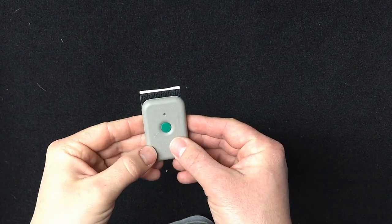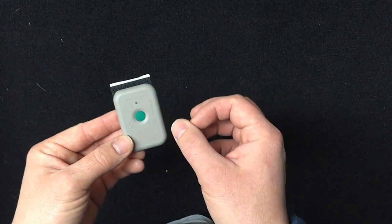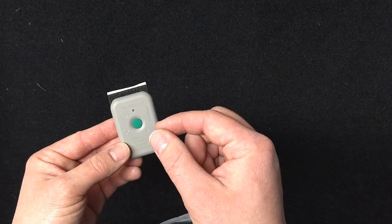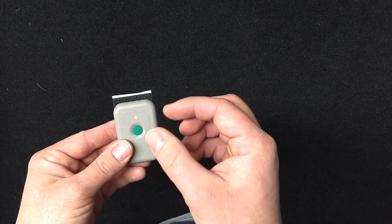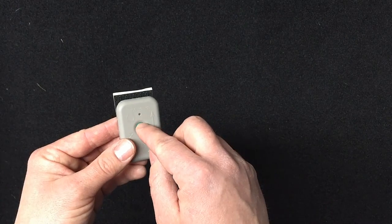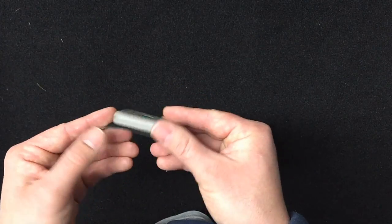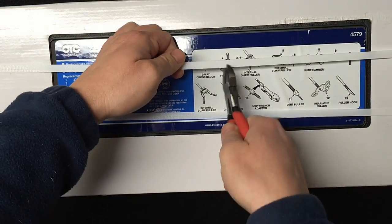The reason this tool is needed is because the new sensors don't have a reed switch inside to activate them with a magnet like back in the day. The old ones you could still activate with a magnet. The new ones are only activated by this tool. And then even the newest ones that used to have reed switches no longer have them, so you now need this for those too. It's a bit complicated, but either way, at fifty-three dollars this tool is going to be awesome. I'll have a future video on this and how well it works.